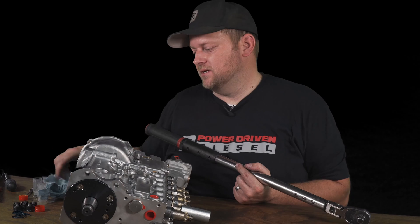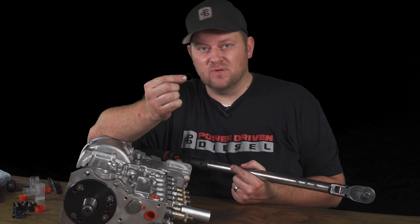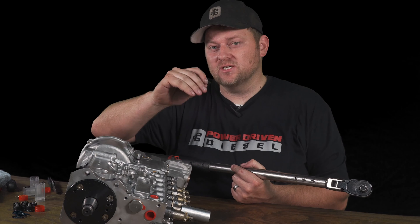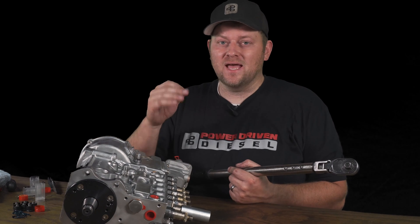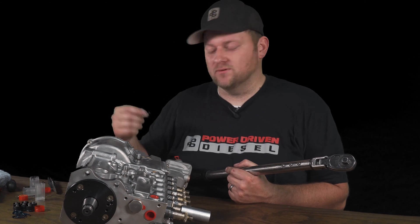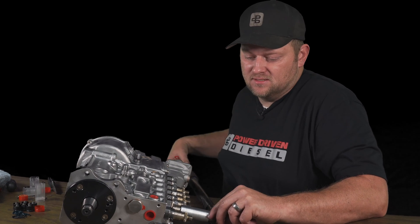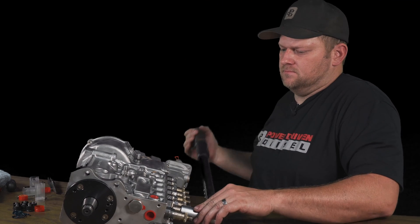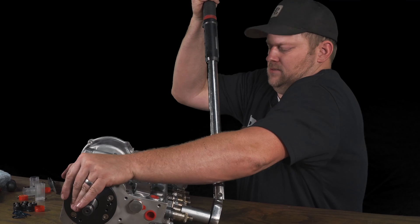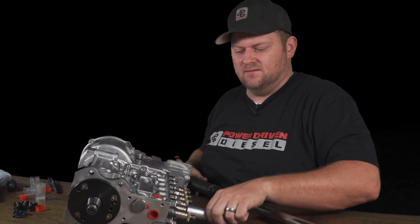Now that we've got all the delivery valves swapped, remember to fish out these little copper crush washers. If you have a 160 or 175 horsepower truck — basically a '94, '95, '96, and newer — if it's the original pump it shouldn't have these little sealing washers. These are a one-time-use crush washer. If you try to reuse them under delivery valves, most likely your truck's going to have a little bit of a lope and a miss at idle. Make sure you get all six of these out. To torque these, you need a torque wrench. Your initial torque is 25 foot-pounds — that's just to get everything seated — and then in one motion we want to go to 80 foot-pounds. Repeat on all six.